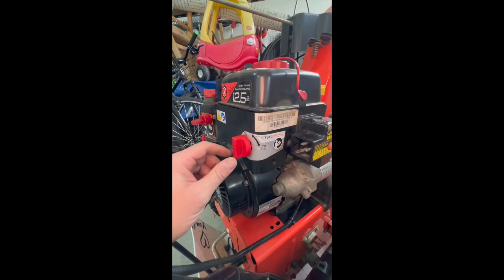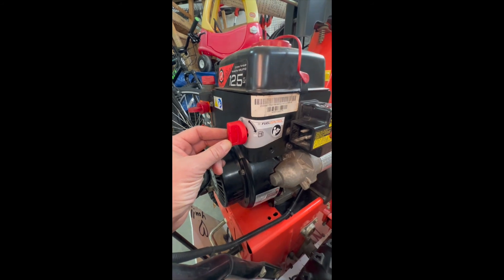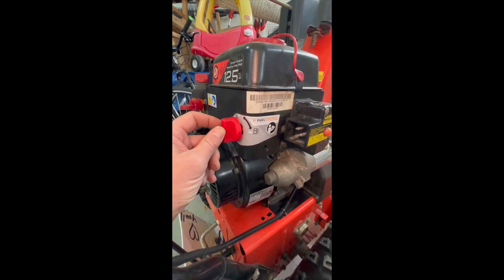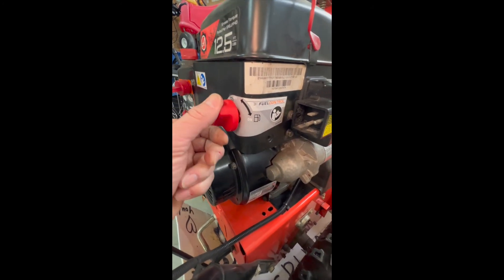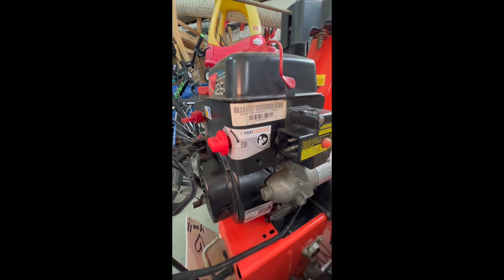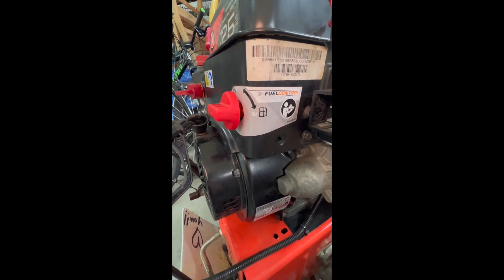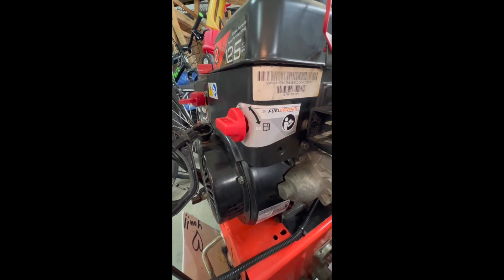Put the plate back on obviously. Hindsight being 20/20, you might want to test it with the cover off so you can see if it's dripping. I filled the tank nearly to the top so there's no question as to whether there's enough gas to reach the line when testing. It's in the off position at 12 o'clock — move to 3 o'clock and leave it on. If you've got a pretty bad drip, whether the plate is on or not you'll be able to see it. If you did a good job getting the hose back on and putting the clamp on and tightening the nut and rubber grommet snug, you should be good to go.